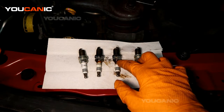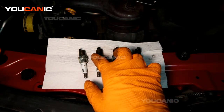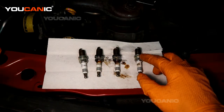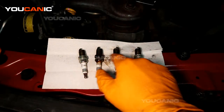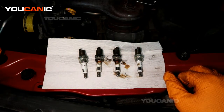That oil has been going by on those two cylinders, so you're probably losing power out of your vehicle because of these two. This one was actually very good, so these two were doing well, and these two definitely had some blowby on them.